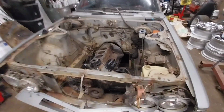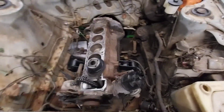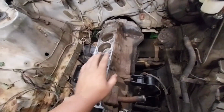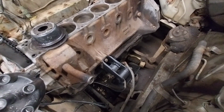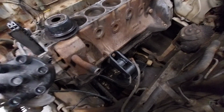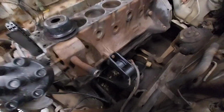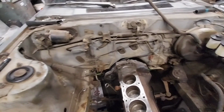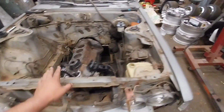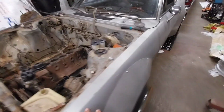As far as I'm aware, I'm the only person that's done this, or currently is going to be running this. This is a mock-up engine. I paid $100 for engine, transmission, complete everything. I modified some universal LS mounts, hacked them apart, and then used a partial factory mount and the LS mounts to mount it in. I did not modify the firewall. No major components were harmed in bolting this engine in. Super close to a bolt-in.